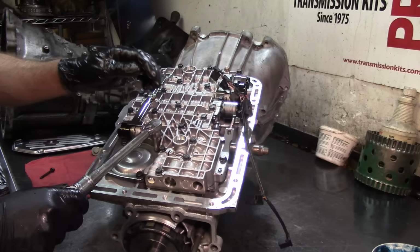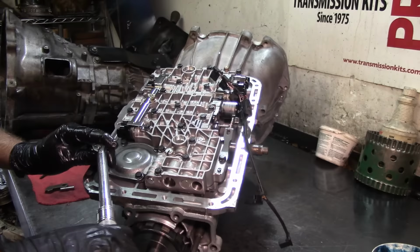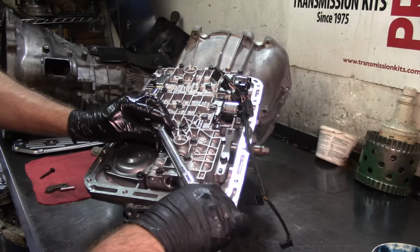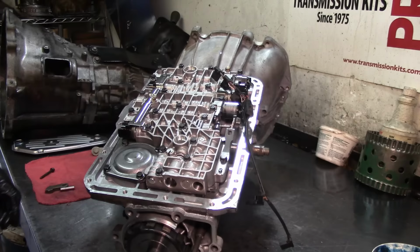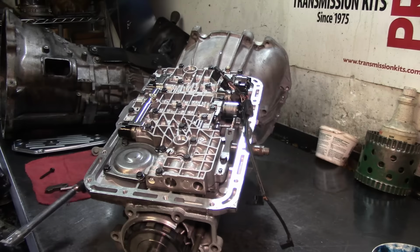It's 115, which is very, very, the bolt doesn't even turn. Just do it a few times. The quality of this gasket is very important as well. I've had low quality gaskets blow up, actually tear. This gasket is like a metal paper gasket. And if you get just the paper gasket by itself, it will fail. So I'm at a 115.